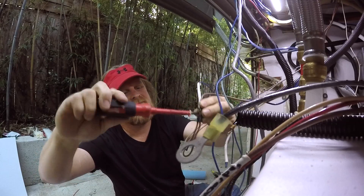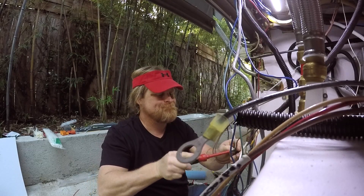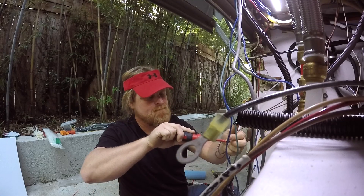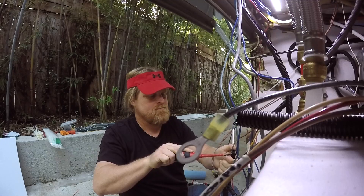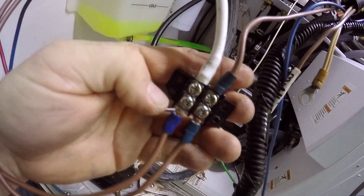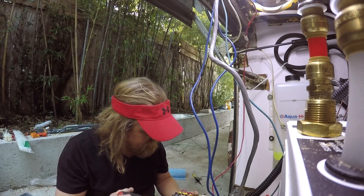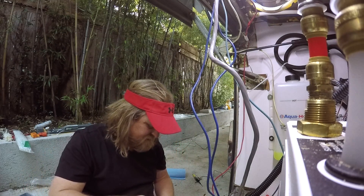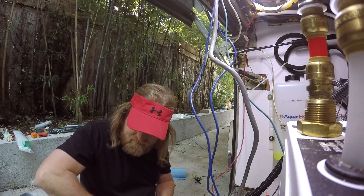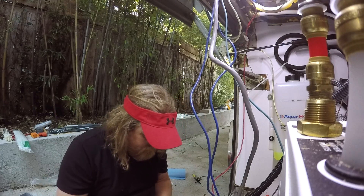So we take one line and make it feed all — tighten them down without busting them. It's cold out here so my hands are not happy. All right, here it is: this is our first terminal block for our Aqua-Hot, and that's for the living room. I have this block that I made for some other stuff — looks like it's been outside and it's a little corroded. But I'm trying to keep my system separate from the chassis, so I'm going to run all my earths back to where they came from.